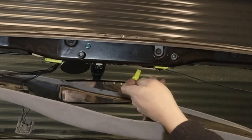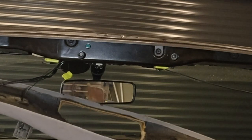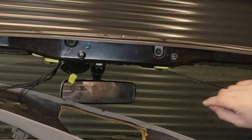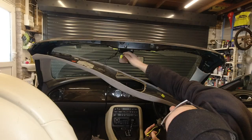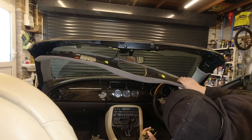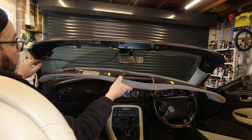With that down, the wiring that goes to your sun visor and vanity mirror lights connects on to these yellow connectors which you can easily unplug. Unfortunately one of mine has been cable-tied up and it shouldn't be, so I'll just get a snipper to snip that. There we go - just pop that up, get to the other side, and we're out.